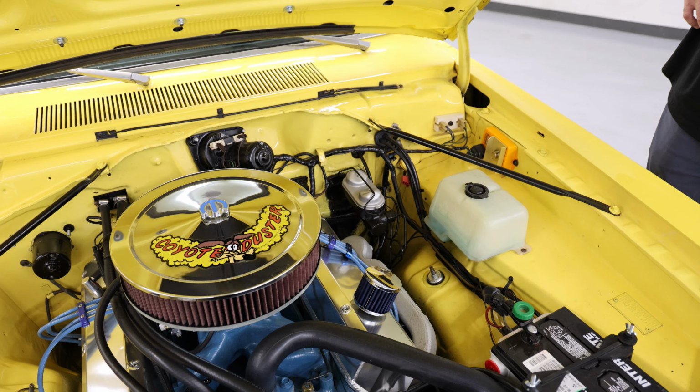Let me guess, it's a 340, right? Here we go. Okay, classic small block Mopar, iron heads, aluminum intake, an Edelbrock dual plane, kind of cool RPM Air-Gap. A small Edelbrock 4-barrel, there's nothing wrong with that. That's a fine carburetor for general performance use.